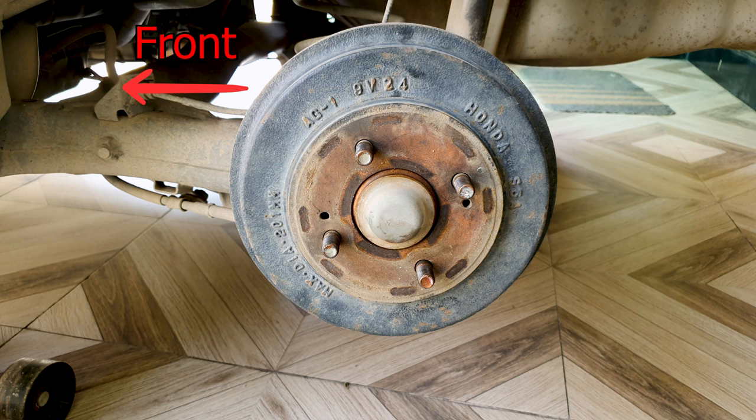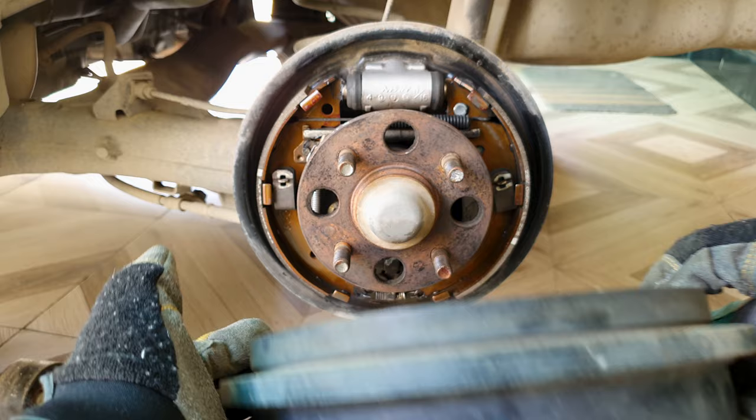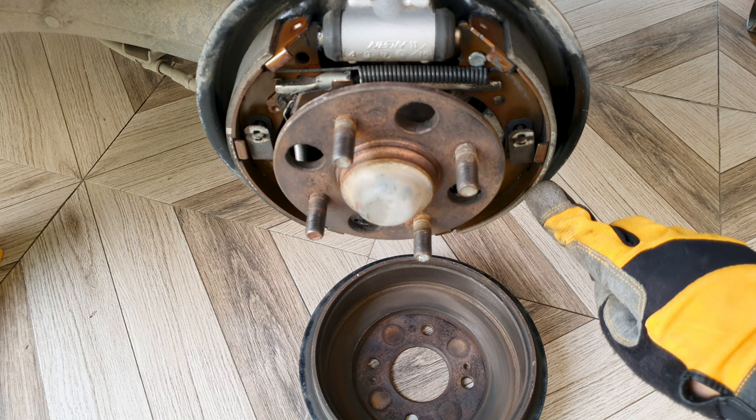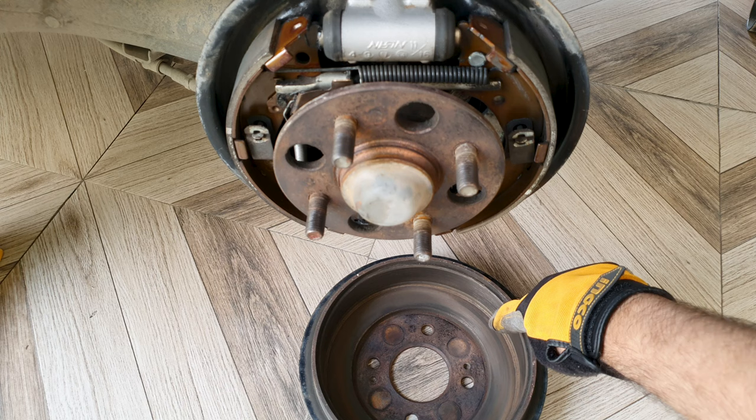Welcome to the channel. The noise you heard — a clunk or clank — means we need to adjust the rear drum brakes. The brake shoe skipping is basically a combination of two things: the excessive gap between the shoe and the drum, and brake material that over time forms deposits on the drum, so the surface is no longer smooth. When you press the brake lightly, it skips on the surface.